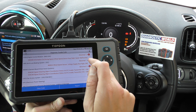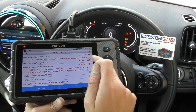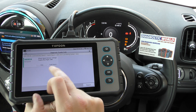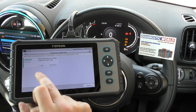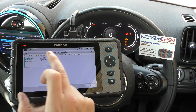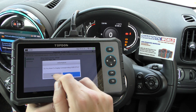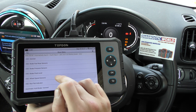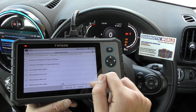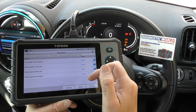This is what we're looking at though — the ABS system. So we'll click into this and then we can click onto read fault code, which just gives us a bit more information about the fault itself. So it's telling us there's a fault with a rear right ABS sensor, which we fully believe. But if you want to double-check, you can go to read data stream, wheel speed sensors, and then select the four ABS sensors and click OK.